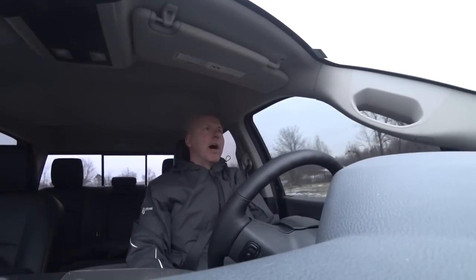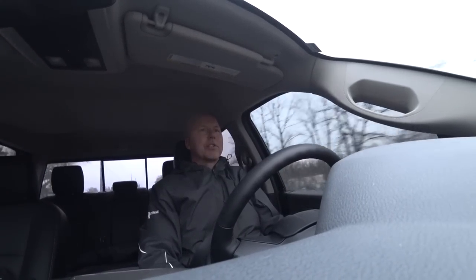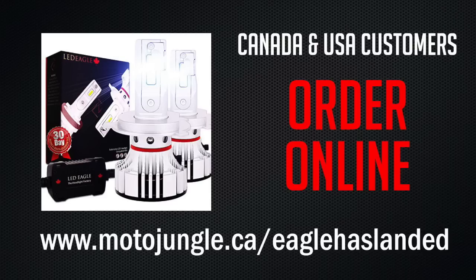Tonight we're on our way to Paul's place. He's got a 2018 Ski-Doo Blizzard — it's the Rev XS chassis, so that's Gen 3 Ski-Doo. He's put in his old LED headlights but stopped short when he got to the dust cap. He wasn't sure what to do with the dust cap or snow cap on the back of the bulb. One option was leaving it off, which I advised against — any dust or snow that gets in there is a problem. For example, you're riding along, hit a drift, that snow contacts the exhaust, steam goes up and will actually fog up the inside of the lens. So we're going over there to check it out, help him finish the installation, put in the LED Eagle, and do a little comparison. Stay tuned.